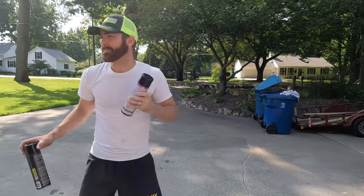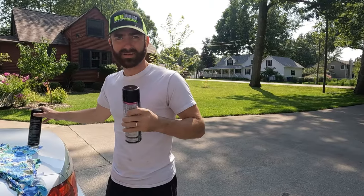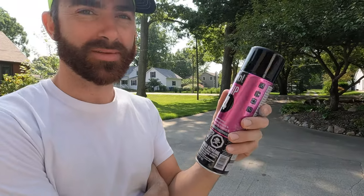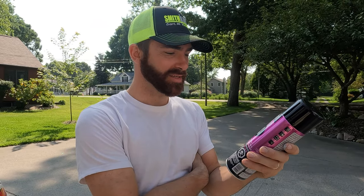What's the other bottle that you have? This is Grip number four, which you don't need to use U-Pol products, but I did because they came with the cans. This is an adhesion promoter for areas you can't sand really easily. So I went through and sanded the whole thing, ground down the metal, then used soapy water to clean it up and make sure it was degreased. Now in the areas I couldn't sand really well in the corners, I'll be using the U-Pol Grip number four.